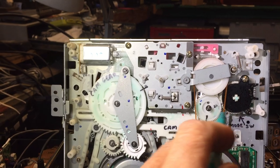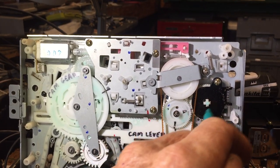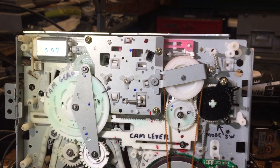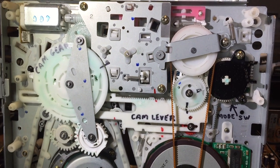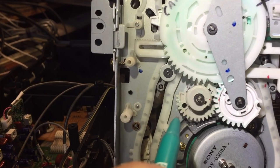If you were to line these up when the VCR is in the play mode, for example, and put it back together, it's not going to work right. This little mode switch is rotating and it's sending signals — logic states — to the microprocessor, letting it know what mode the VCR is in. So you can imagine what would happen if this thing wasn't lined up right.